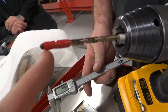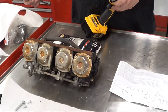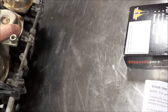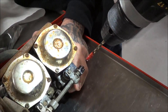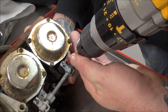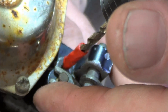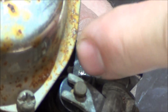If we go too far, we risk drilling the mixture screw underneath — that would not be desirable. Normally when you drill you'd put a center punch, but we can't in this case because using a center punch would accidentally drive that plug right on top of the screw. Danny's got to be very careful — 90 degrees, standard position, using a standard wood screw setup. He's using no lubrication because we're drilling in a soft metal — brass.